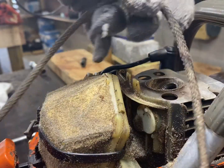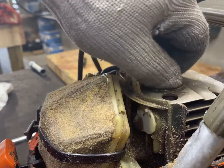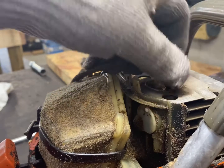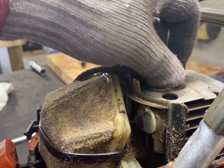Take your piece of starter rope and just double it back. We're going to stick that loop into that piston hole, being careful not to go so far that it comes out the exhaust port and gets pinched. You'll just kind of wiggle that clutch and you'll feel it when it catches.